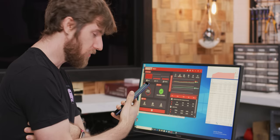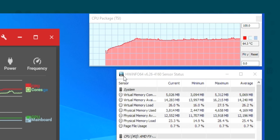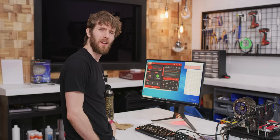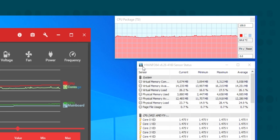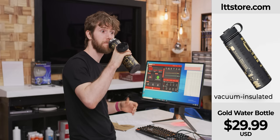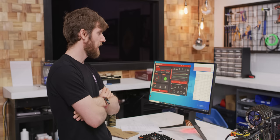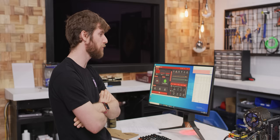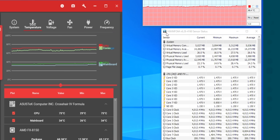I want to see a nice flat line before starting our two-minute run. It starts out high from our heat gun shortcut, then comes back down and creeps back up again. I'm trying to wrap my brain around how the same thermal interface material can perform differently over time — maybe Tech Ingredients could do a follow-up explaining this. Is it expanding? How long should it take to reach equilibrium? We just touched 68 degrees, and right as I was saying we had a consistent upward trend, it thermal throttled — two cores dropped to 1.4 gigahertz. We can't give it a temperature score at that point. That's just a fail.